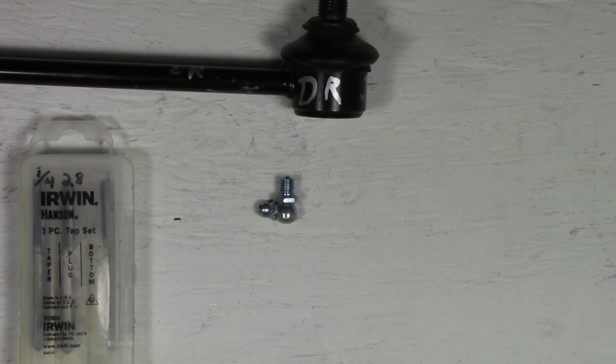And I'm good and tight there. Actually may use a little bit more or a little thicker washer on that, but regardless, that's the point behind those washers. And I still check to see if I have range of motion, and I do, no problem at all. So that's not gonna hurt anything. And I'm gonna do the same thing on the rear part, like on the other side, this side here. And then I'm gonna show you how the grease flows through the actual ball joint as well. How it does when the boot is on.